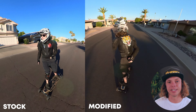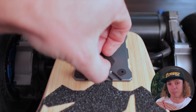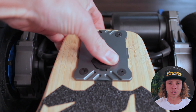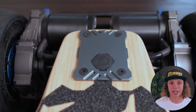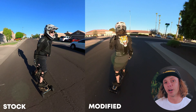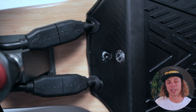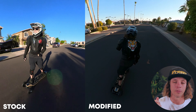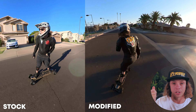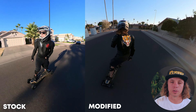The Nomad also has a top charging port — I love this about ASTEC. They put the charge port in the top plate where your truck is. It's got a rubber opening now that's much easier to open and close than the old generation one. Flip it open, charge your board — you don't have to turn it upside down. The power button is underneath the board at the rear. If the board's been turned on in the last 24 hours, you can turn it on and off from the remote. Just turn off the remote to turn off everything; turn on the remote and the board turns on — you're off and running.